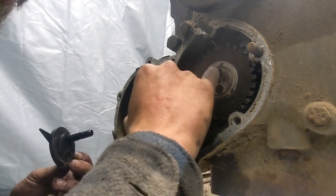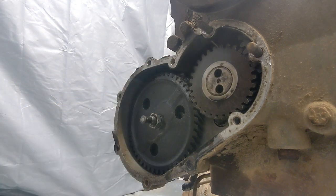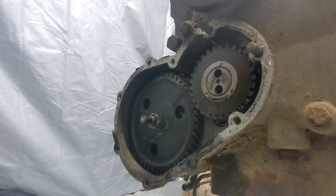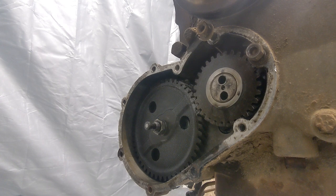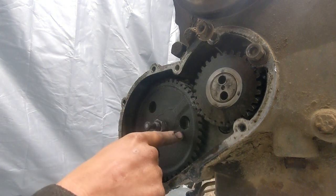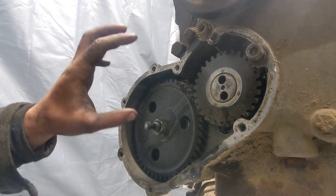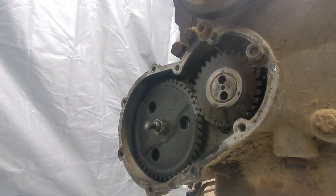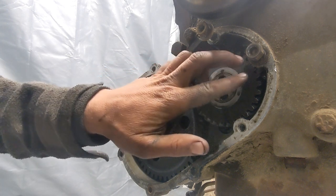Don't lose those shims - they're going to be important later. I think I need to put some punch marks on this. It doesn't say anything about punch marking these gears in the manual, but this is the camshaft connected to it, this is just an idler pulley, and this is the gear that drives the injection pump. So if this isn't timed correctly, it's not going to inject at the right time. There's a punch mark on this gear, two punch marks on this gear.